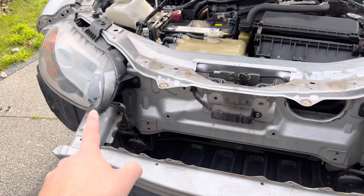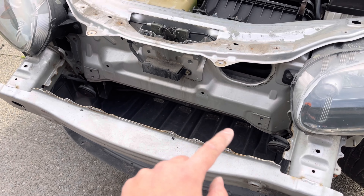I thought I could do this without taking off the bash bar, but I've had to unbolt it from both sides to get this plastic piece off — it's kind of like a water deflector thing. Anyway, I've unbolted the bash bar and now I need to take off the airbox and the MAF sensor, then mock up the new intake. Finally got the intake box off — I'm left with this mess. It feels plastic, but I'm about to mock up the new one. Last time I didn't read the instructions things went terribly wrong, so I might read them this time.